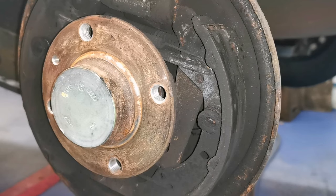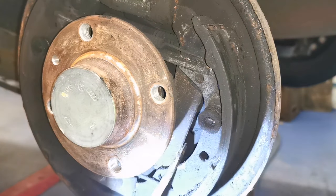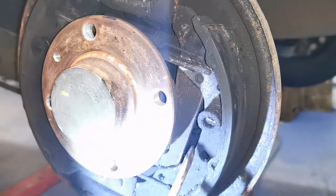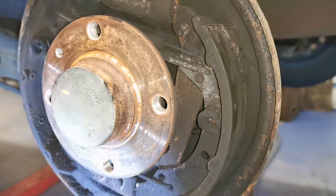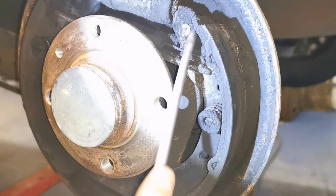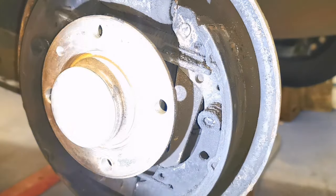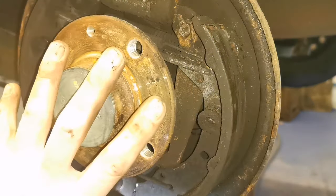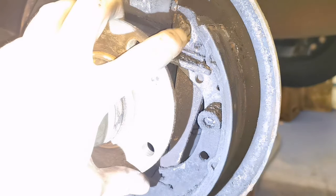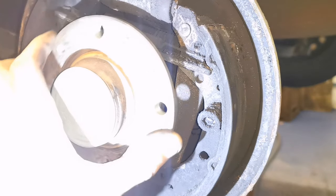If we prize that, it just stays in position. There are a couple of things you could do - you could take these shoes off and loosen all this up. There's the rivet or pivot point of that lever and it's just corroded up. This is a very common problem on all Volkswagens with shoes - this lever sticks, and the cable can stick as well. This lever is stuck here - we can see it's not springing back.